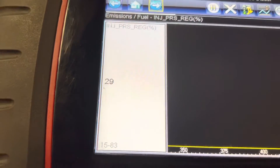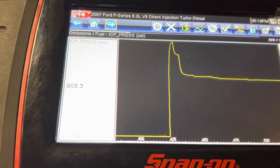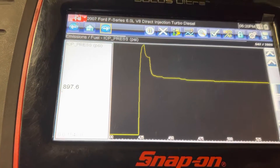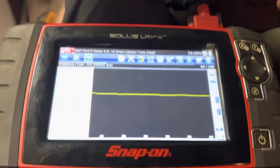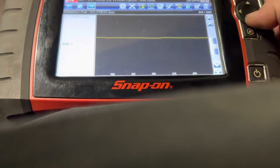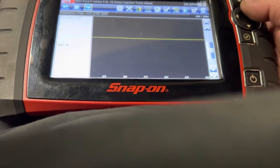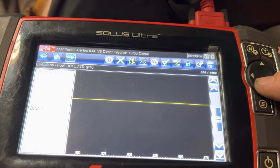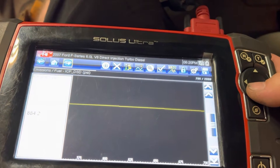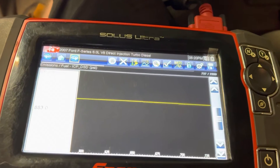You can see how the percentage hovered down — it never hit 85 percent. The ICP pressure is a lot higher than it was; it was only getting to about 755 before. I'm just going to let her idle — she's smoking a lot, and I probably do have a stuck injector, most likely. Everything looks pretty steady so I'm going to let this run for about 10–15 minutes, let the air get out, let it clean up. It already feels like it's starting to clean up. It's a success — wasn't the high pressure oil pump, thankfully, because that would have really sucked.